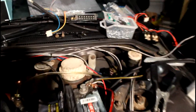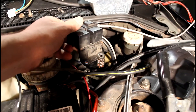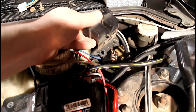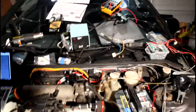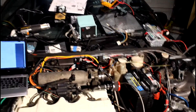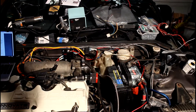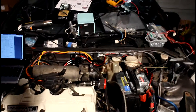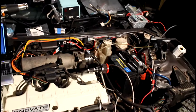Something else I've got left to do — these female relay pods here go to the auto shutdown relay and the fuel pump relay. I have to rig those together so that the Mega Squirt can power them. Unfortunately, the output of the Mega Squirt is only good for about one of those automotive relays on the fuel pump output, so I've got to daisy chain those relays so that one of them flips the other one. There's a lot of information out there on that, so I'm not going to go into exactly what I do for this car.